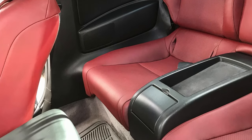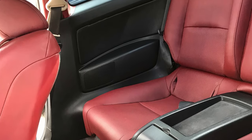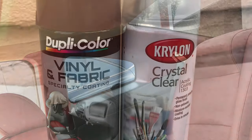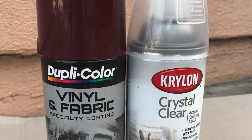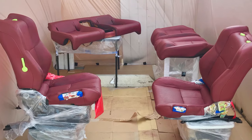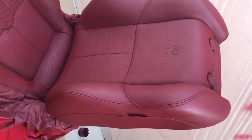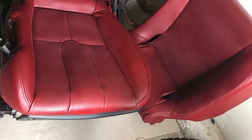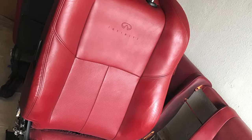The seats are by far the hardest thing to paint and easiest to mess up — it takes a lot of patience and you can't rush it. Here's the finished seats and the upper side panels fresh after I installed them in the first G35. Once I got my new G, I swapped out everything I had already painted. While I had the seats out, I decided to touch up the paint where it started to rub off. I stepped up my prep game using 3M masking film to create a makeshift paint studio. I used three more coats of the burgundy, then added a couple light coats of acrylic finisher spray to help seal in the paint and make it more durable — it really made that color pop and shine.